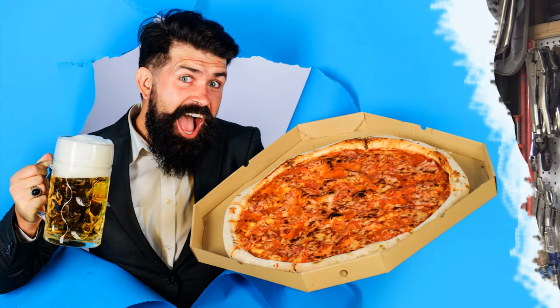All right, so what I'm going to talk a little bit about today is brake bleeding and a couple of different ways that you can do that. Now, the first method is the oldest method that I know of that I've used for years, and that is the two-man method. So you will have to buy pizza and beer possibly to get this one done. You have a friend come over and get in the car, pump the brakes for you to get the pedal to start coming up, and then you open the bleeder screw up. The pedal goes to the floor. They hold it there. You close the screw, and then they do it again until you can get a good firm pedal out of the car.